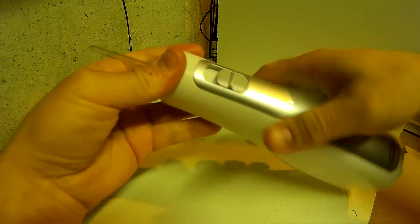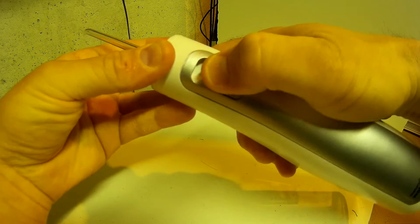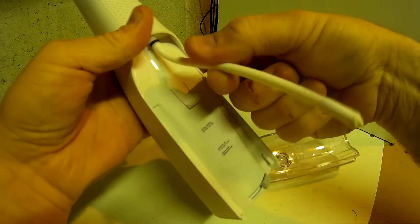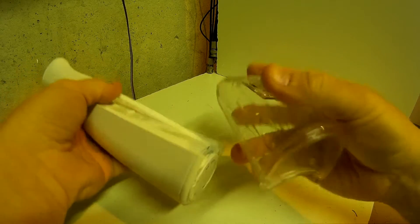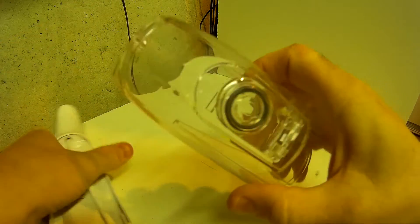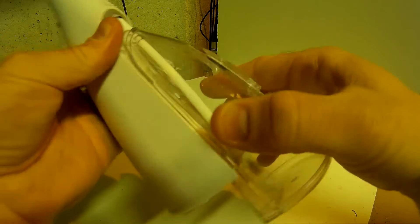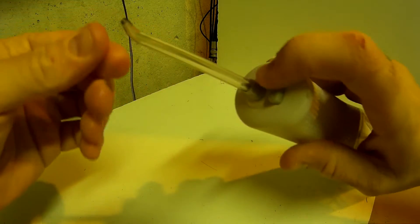First of all, you have an on/off switch and two levels — one and two. There's a reservoir here that comes off; this is the tube that sucks in the water, this is the water reservoir. What you do is you open up this little flap and pour water in here, then close it shut. The rubber seal will ensure that water doesn't leak out of this area, and then the tube slides into the top and just slips on and clicks together.